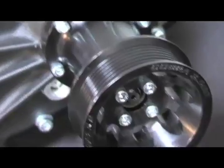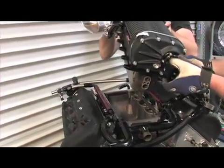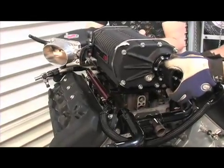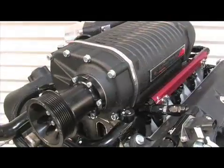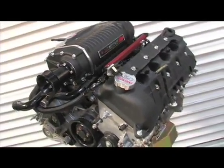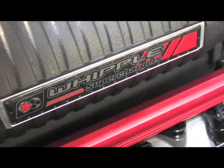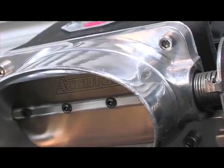Topping the rebuilt engine is a new twin-screw supercharger from Whipple Industries. Whipple's standard Cobra upgrade blower displaces 2.3 litres per revolution and will produce up to 23 pounds of boost. But we went straight to the bigger 3.3-litre supercharger for more boost at lower pulley speeds, and stepped up to a single-blade AccuFab throttle body to replace the dual-inlet stock piece.